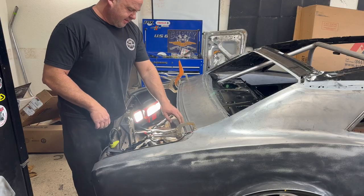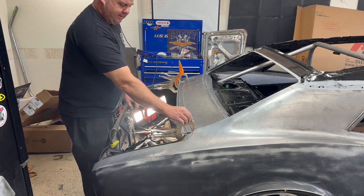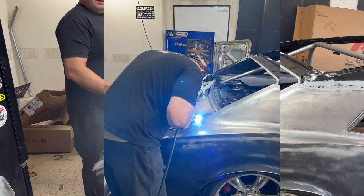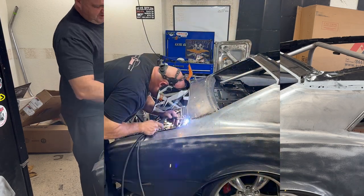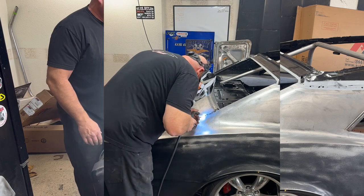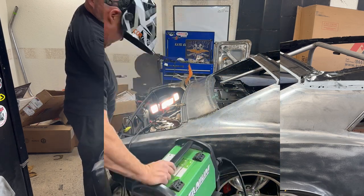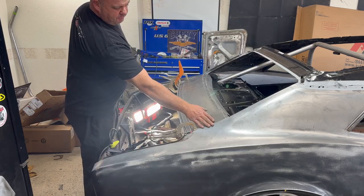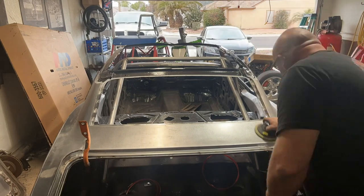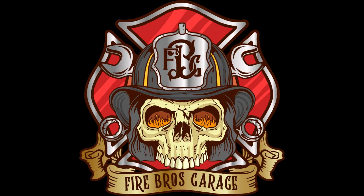I set up this panel all the way down into this gutter and it's good there — it's just right here where it doesn't line up at the body. So I use body clamps here and here to get the body line totally level. In my build you've seen that I'm shaving all the body lines out, so this is really important for me. I'll start by putting some tack welds in this, then pull this down and weld it after it's tack welded in place. Because if I pull this down, it makes this panel about an eighth inch under the quarter panel here. So I want it as even as I can get it.